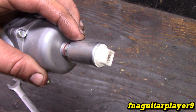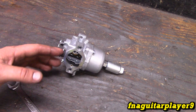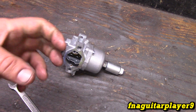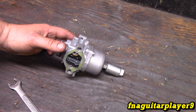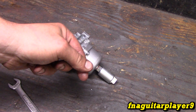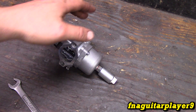This is called a fuel solenoid or an after-fire solenoid. On a lot of older engines, when you turn the key off, your engine coasts until it finally quits spinning, and your gas is still being pulled into the engine. So if your muffler is hot enough to create a hot spot, it'll ignite the fuel and cause a little backfire after the motor shuts off. It's common on older engines — doesn't really hurt anything but it can be annoying and scares people. So that's why they came out with these. When you turn your key off, it shuts power to this, which shuts fuel off going into the carburetor and the engine.